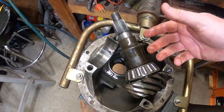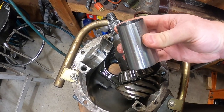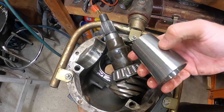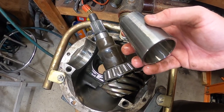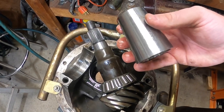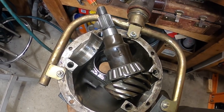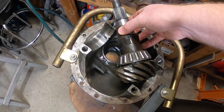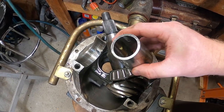You've got to get rid of the old crush sleeve and either use a new crush sleeve and crush it down to 200 pounds, or you can use what's called a crush sleeve eliminator. You can see it's far thicker — it's a conical style sleeve and it's reusable. So if you're planning on upgrading the gears or you're building a race setup, a crush sleeve eliminator is probably a far better option. A lot of racers feel that this big stout cone will hold up a lot better to the pressures as your driveline hammers on the pinion.